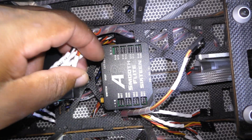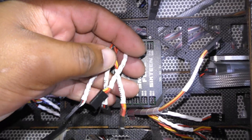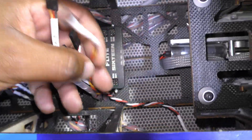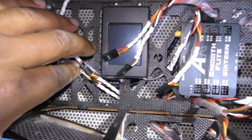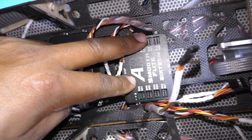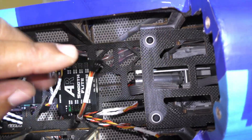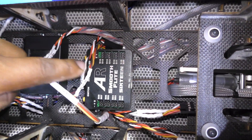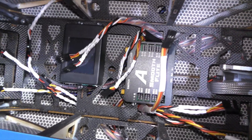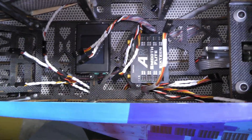Here is what we have — again, chafe protection, I'm going to keep mentioning that. My wires are all labeled, so I just need to plug these guys in, plug the gear and brakes in, and plumb my batteries. The manual suggests batteries set up here, so I'm just going to do the wiring from up here to my smooth flight, from my smooth flight to my gear controller, then add my receiver, and we'll show you once this has been cleaned out.